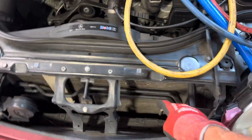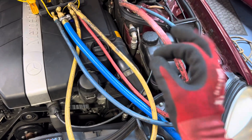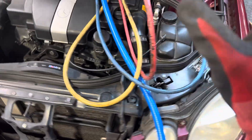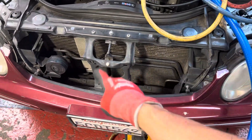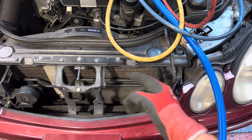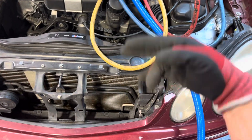We had the old condenser, we had a black burnt-out compressor, and I was really surprised — when I put brake clean down there into a clean glass, metal particles did not come out of the high side or low side. We can see some in the pistons, a little bit on the side. I know there were some metal particles and some of that coating on the pistons is inside the condenser, trapped in some of the passages. There will be reduced cooling efficiency because of a couple of blocked passages — every one of those refrigerant passages has many little tubes with fins, so some will be blocked.